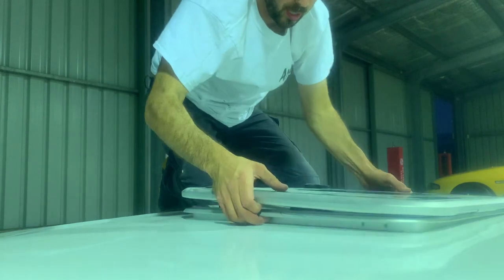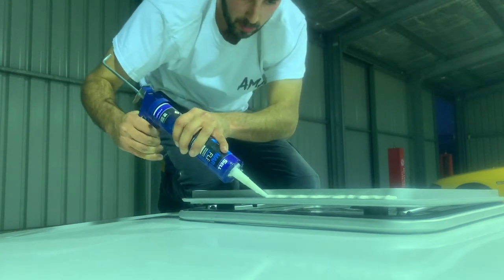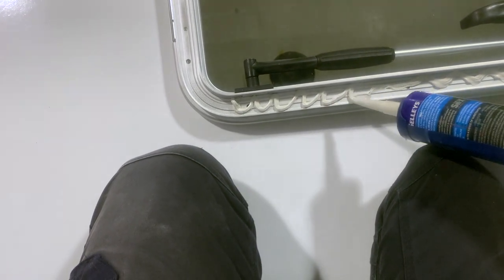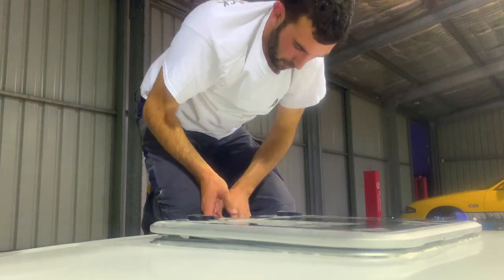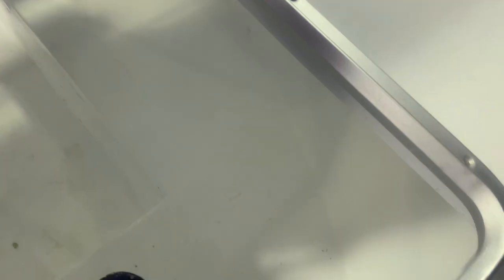Really happy with that, actually. I'm just going to put this hatch down — it fits really nicely, absolutely stoked with that. Never installed one of these before. Just like we installed the outboard, we're just going to use the marine silicone to seal up the hatch to the boat, and then we're going to screw it in place with some stainless steel screws. I'm just going to slide it down into position. Looks like I've got enough silicone because it's pushing through the holes. You want this to open up from the front to the back — just like so. I'll screw these in and let's see how she looks.